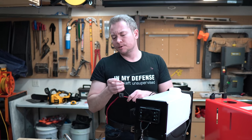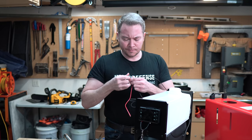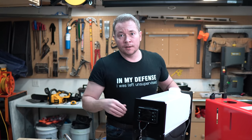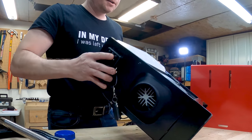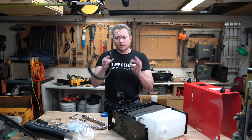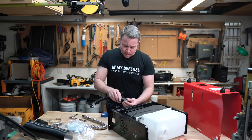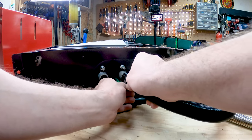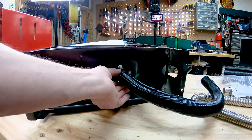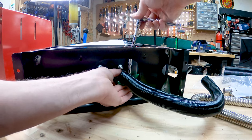Power is just 12 volts — it's got a ground line and a hot line with a fuse. This is a 20-amp fuse; I don't really like this, I think I might do a different type of fuse here. Anyway, the first thing we've got to do is hook up the intake and the exhaust on the underside. Starting with the intake line — it's pretty straightforward, just the hose and a hose clamp. The fuel line gets a little bit in the way, but at least there's enough room to get a socket or nut driver through.